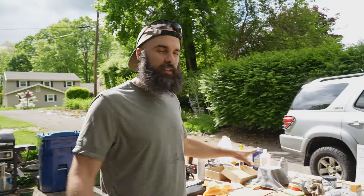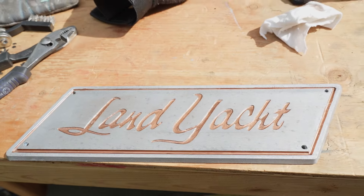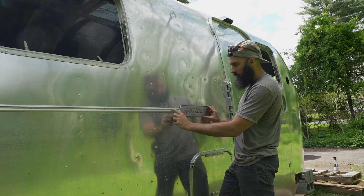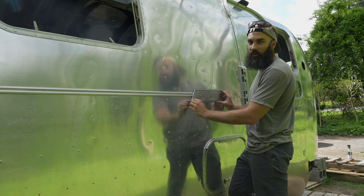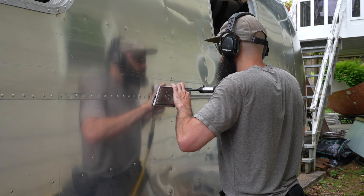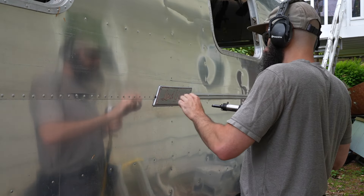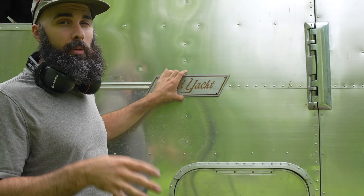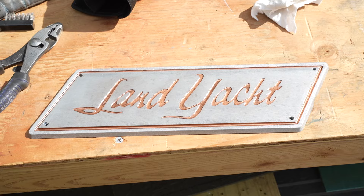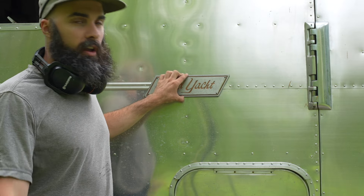We have our final coat of paint on all the things we're putting on the Airstream, and it looks awesome. This plate is going to go here — it looks sick, it looks fresh. We're going to follow the same orange line, or rose gold. These were originally held on with regular pop rivets, but we don't have any that are long enough to go through what I believe is cast aluminum into the shell. So we're using buck rivets — it might not look as aesthetically pleasing, but it still looks good and I think that's really all that matters.